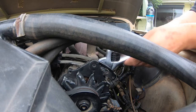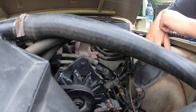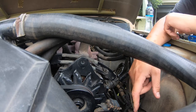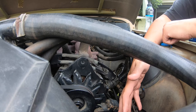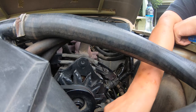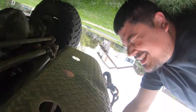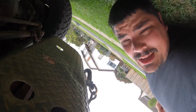We can push the alternator back across to loosen everything up. Now we have to crawl underneath and loosen the jockey wheel — or jockey bearing, as the service manual calls it — which is the belt tensioner. We need to get underneath and loosen that for the alternator belts. The new belts have stretched a little, so let's get underneath.